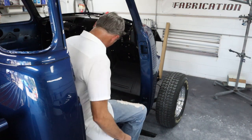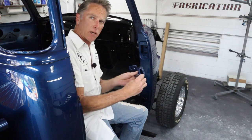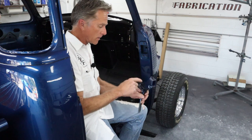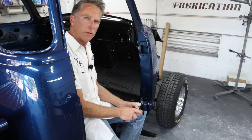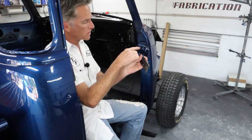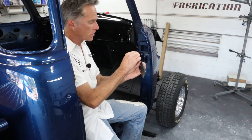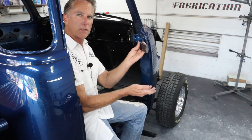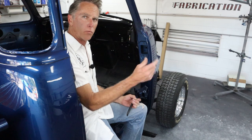Now that I've got the holes ready to go, some of these hinges are a little hard to get in there, so you have to be careful putting it down inside the hole. You may have to bump it a little bit if you've got a lot of paint around the edges - luckily the flange will cover that up. I'm gonna get them in and raise them up; the holes are slotted so I'll snug the bolts until the hinge is about in the center as a good starting point.